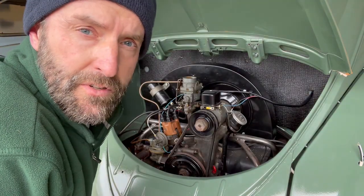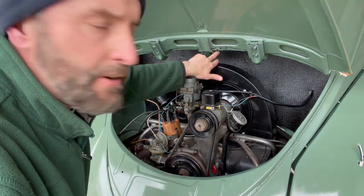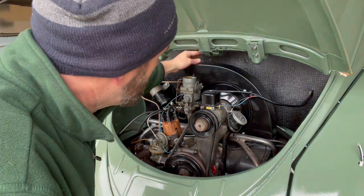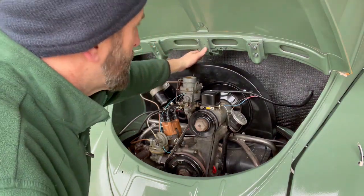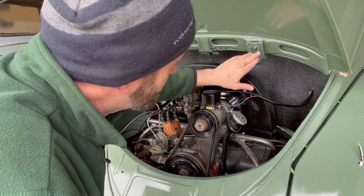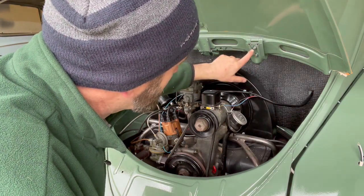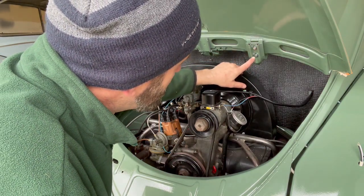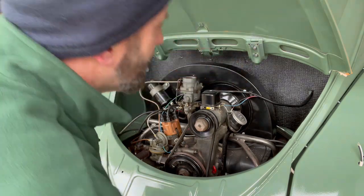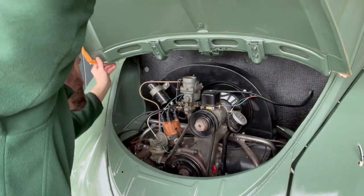Okay, well, the car almost ate me, but I got the spring back here. I'll maybe get a close-up picture to show the right positioning of this spring. That's important too. Forgot to mention when I was talking earlier, probably hard to see in the video, but I took a little Sharpie marker and marked here where I think the bolts should be, at the midpoint. Just so I have this position right. So I'm just kind of knocking this into place here.